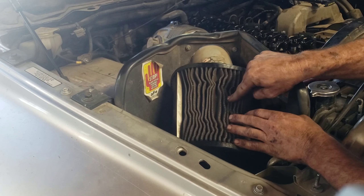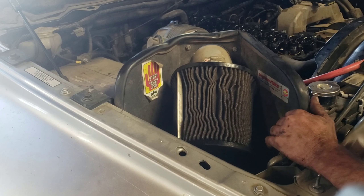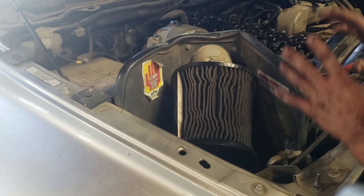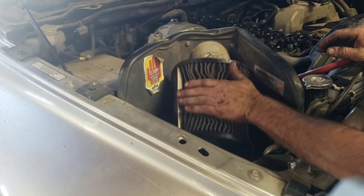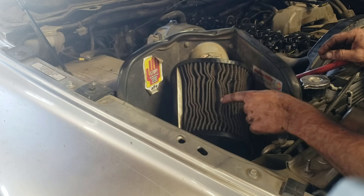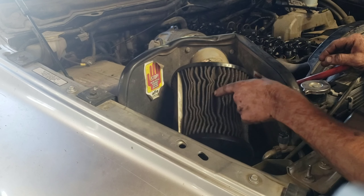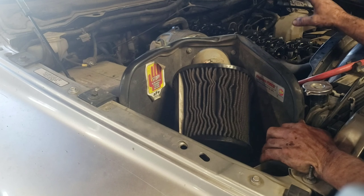When it can't suck air with a diesel, it's going to start sucking oil out of the engine and it's going to burn the extra oil — it's going to do all kinds of bad things. This is not good. What's also going to happen is eventually junk is going to find a way through here and then you're going to dust your engine.